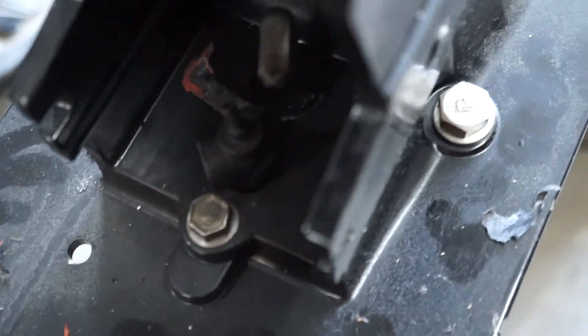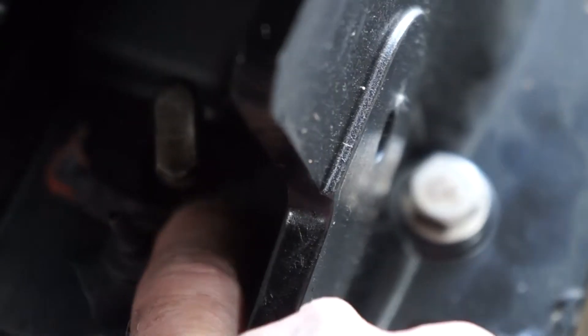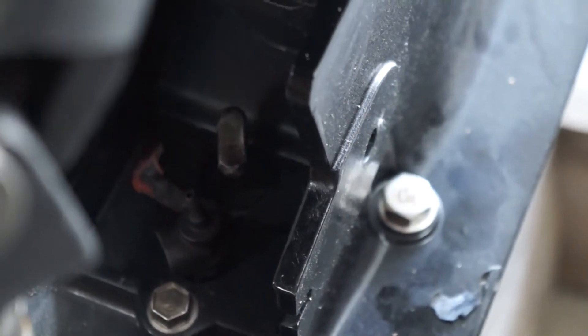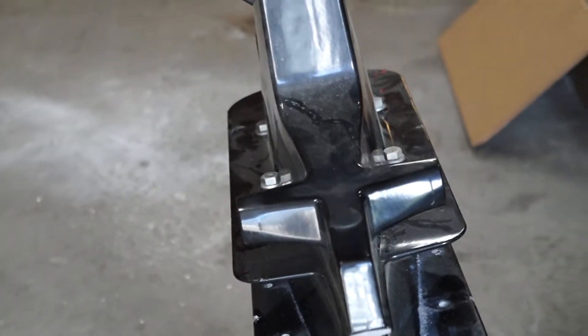I'm not sure I'm going to have enough light with this camera, but that shift shaft — it's slowly zooming in right there — where the shaft goes through the housing is leaking on a pressure test, so that's a definite need. The upper half seems good; we've just got a couple issues with the lower half. So we're going to pull it apart, double-check the water pump, see if we need one of those, and let the customer know exactly what he needs to give him an estimate.